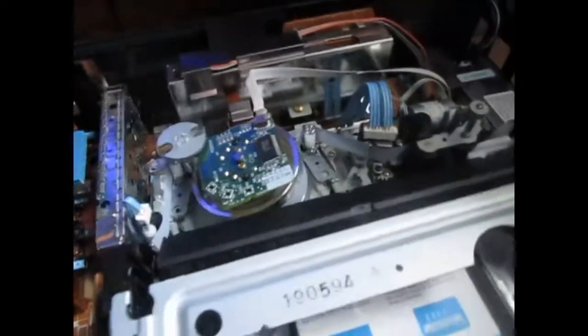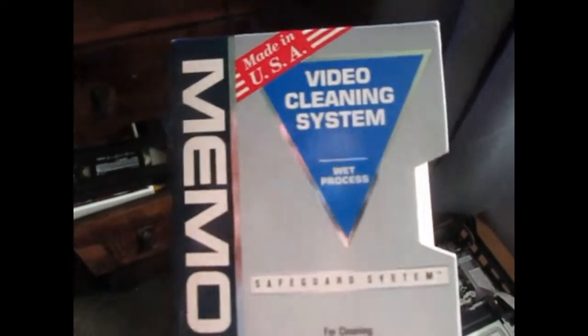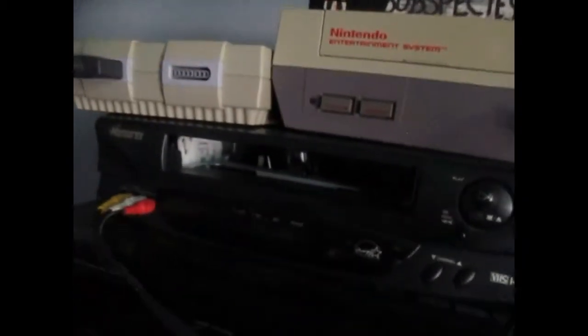I had to clean the drum again with the paper. I had to clean the tape head with the recording head with the Q-tip, and then I decided not to try this again. Not gonna play that again. We went straight to putting in this guy, which you just saw, and it played perfectly. But we learned this guy from eBay, like we saw in the previous videos, it wouldn't play on this one, which has never had any problems for a long time until this thing came along.